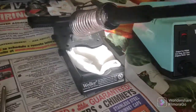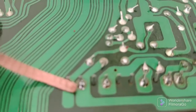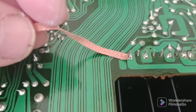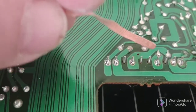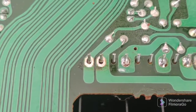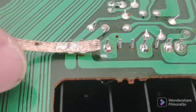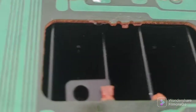What I'm going to do is heat up all of these points. I have my soldering iron right here warming up, and I'm going to use solder wick. You place the solder wick between the solder and your iron, hold the iron on it, and you'll see the wick wick up the solder. Don't hold your iron on there too long because you don't want to lift the copper off the board — just long enough to get these off. You're not going to have any problem lifting copper on this board because these are pretty substantial traces and it's a high quality board. I just wicked the first two together — held the solder wick right across both, and as the solder wick gets filled I started moving it to the right so you can get fresh wick in because it will get saturated.